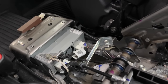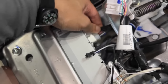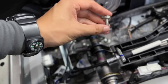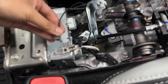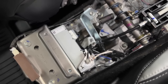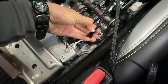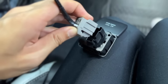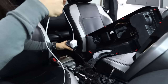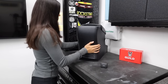Remove the factory harness from the inverter and tee in the Guild harness. The Guild harness goes in place of the factory one, and then the factory one plugs into the other end of the Guild harness. There's also a ground wire coming out of the harness with an eyelet — chassis ground is right nearby, so remove the 10 millimeter bolt and ground the eyelet there. If you're not doing the outlet, you could put everything back together at this step. But since I'm adding the outlet, let me test it first: connect the second long harness to the first one, then plug the end into the outlet. Everything looks good and working as expected. Now let's get to the cutting.